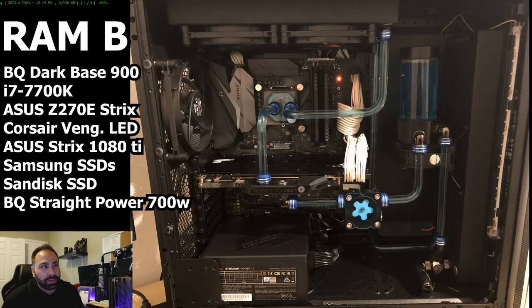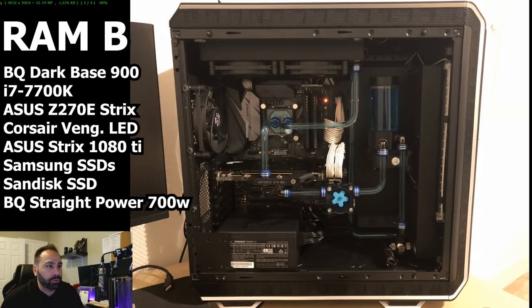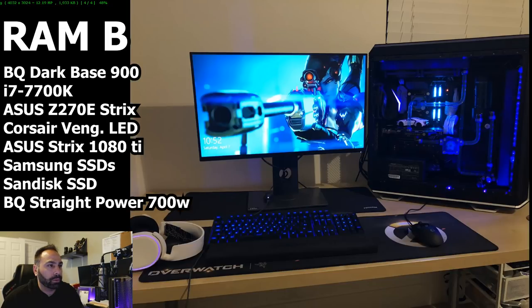This system looks very nice. I would do some training of these cables — tuck this portion of the 24-pin back through that grommet and flap those grommet flaps forward so they're covering them up, because right now it looks like the cables are just trying to escape. Clean that up a little bit by pushing the cable back through the grommet and flapping the black flaps forward so all you see is black instead of white cables. Get some combs in there and straighten them out a little bit. But yeah, for your first loop you did a really good job. I really liked those bends and the PrimoChill fittings look really good too. Good job — nice setup.